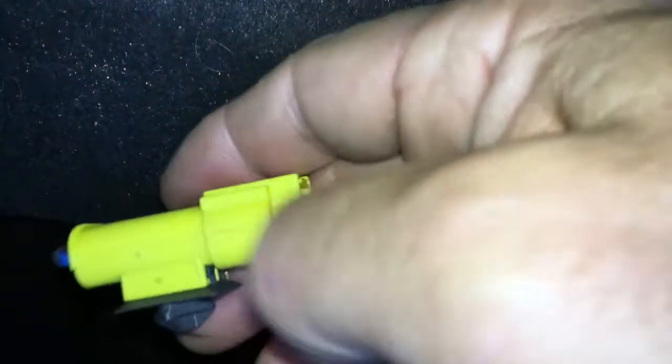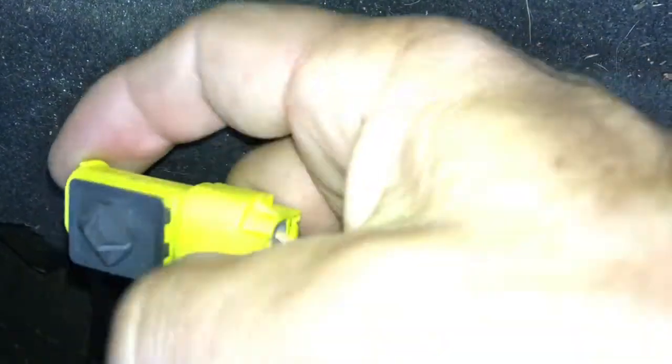There's a very common cause of that which is located under the seat in the passenger area. You can see here there's a connector pulled out a little bit — it's normally attached by a little hook onto the bottom of the seat, but it quite often comes loose.